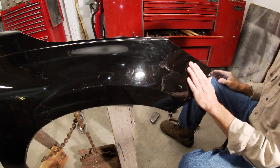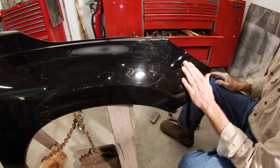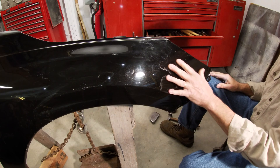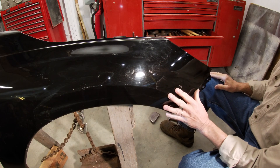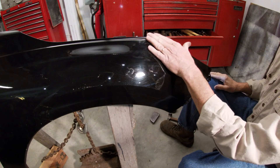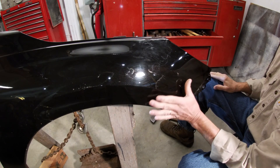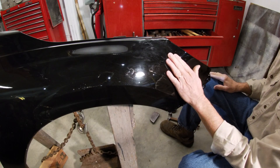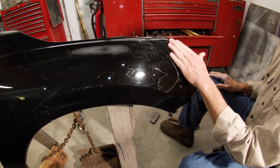It's feeling pretty good. I think the next step would be to take a DA with some 80 grit buzz over it, and that's going to show up any high and low spots. Total, I've probably only got 30 to 35 minutes to get it from where it was to right here, so it's probably about 95% straight. A few little ripples here and there would show up with the DA. I hope that gives you a better understanding of what you can do with your hammers and dollies, how the metal works, how one part of the dent affects the other. That'll do it for this video — thanks for watching.